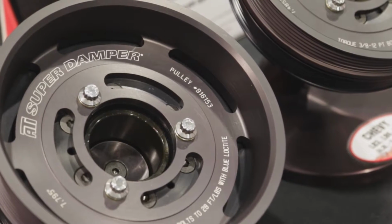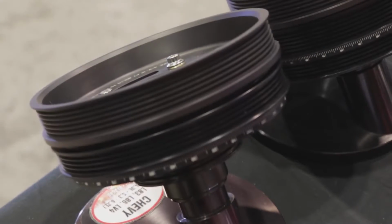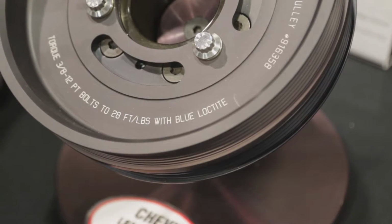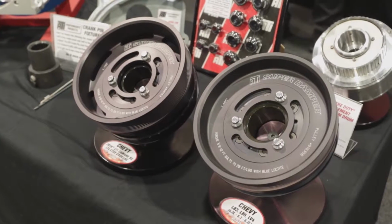For a viewer who may not understand, he just bought a new Camaro, got the V8, he loves the car. Why might he want to upgrade his damper? Sure. We really don't meet many people that say, I've got too much horsepower, I want to get rid of some. So as they do bolt-ons and different items, when the factory damper was conceived and put on the engine, the engineers sourced that and tuned that damper to work in a range that they considered the driver would always drive it. When you go and, let's say, either you're tracking the car, or maybe you're like me and like 0 to 60 at every stoplight, then it's outside of that range, and the damper, is it working?